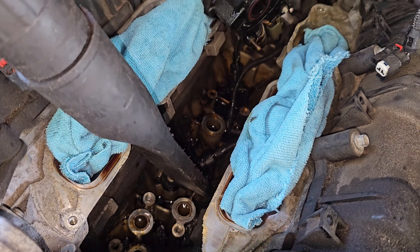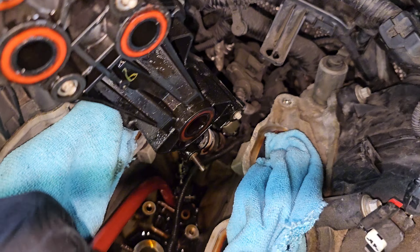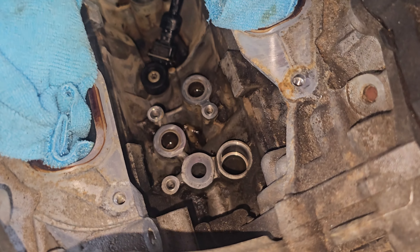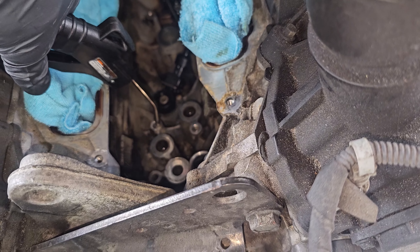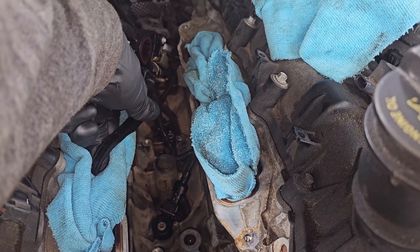It's a mess here but that's what it is. There are my attachment holes. Clean everything up — use brake cleaner, make sure everything is oil and coolant free. Clean all this trunk up. Use a razor blade to clean up those flat mating surfaces. Use compressed air to blow those screw holes out, because otherwise you might break your screw screwing it in because the liquid has nowhere to go.